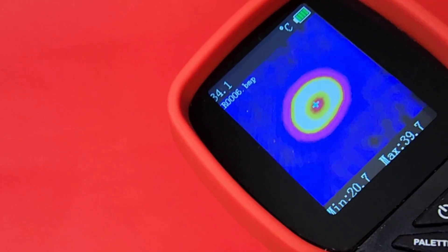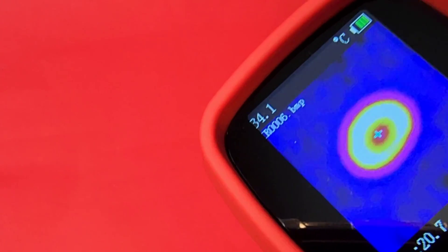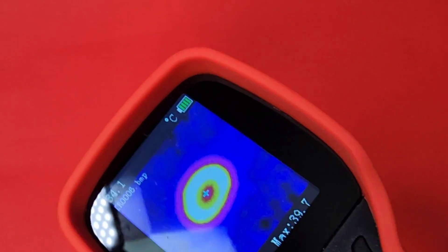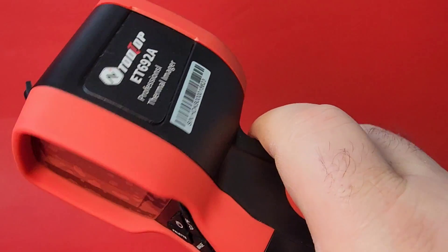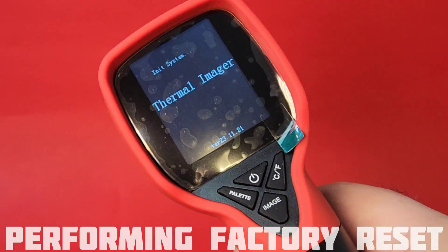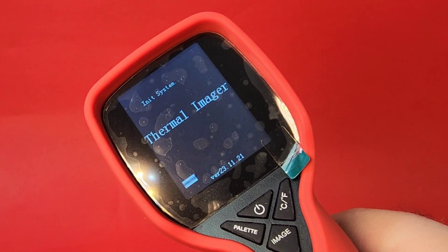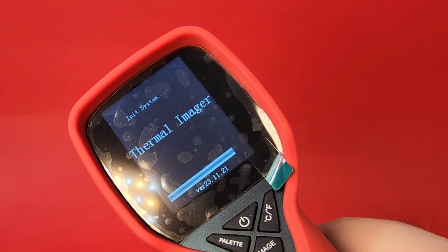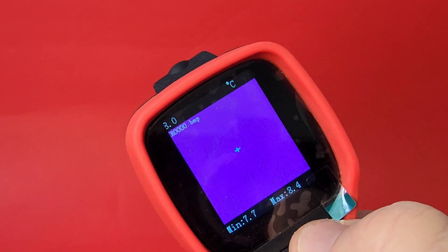If you want to delete images, the product does not support deleting single images. The only way to do a mass delete is to reset to factory settings — that's another quirk. At least you should be able to delete those images after you've taken them, right? To do the reset: hold down the trigger key, press the power button, and keep your finger on that trigger key. It will restore factory defaults — it doesn't tell you that, but it is. If you go to cycle through images, you won't have any anymore.